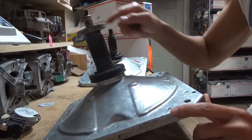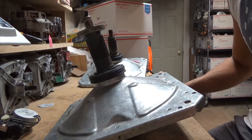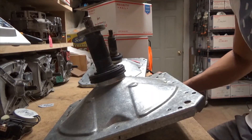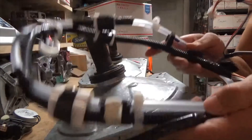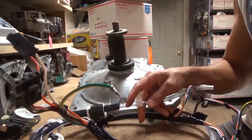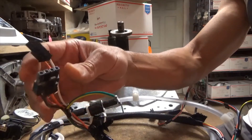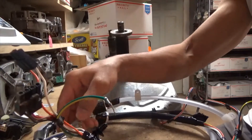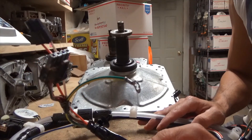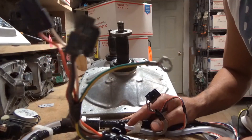So there you have it — between your rotor, your stator, and your gear case, it's probably going to be one of those. Now if it's not, you could also look at the wiring harness. These go bad sometimes too — wires could fray, mice eat the wires, or the connections go bad. So that's your fourth option. Really, there's not anything else to look at besides those. I hope that helps — please subscribe. Thank you.